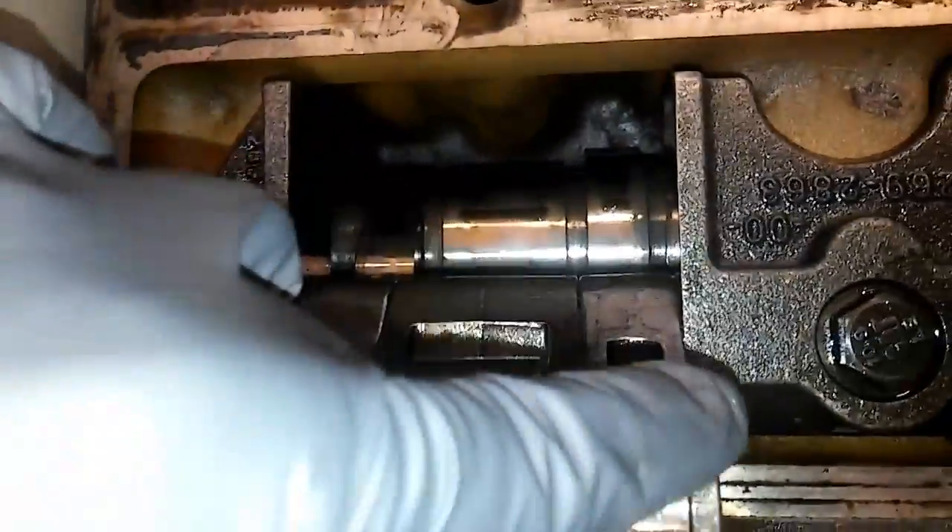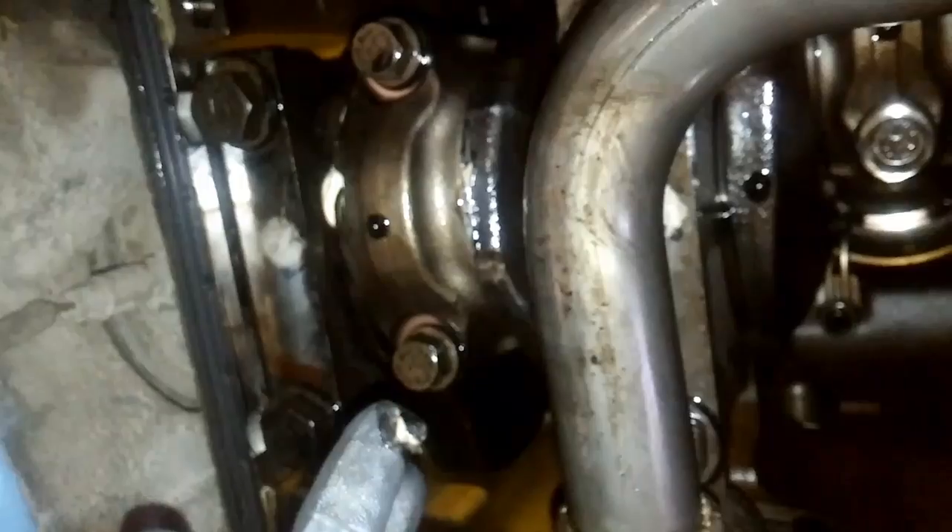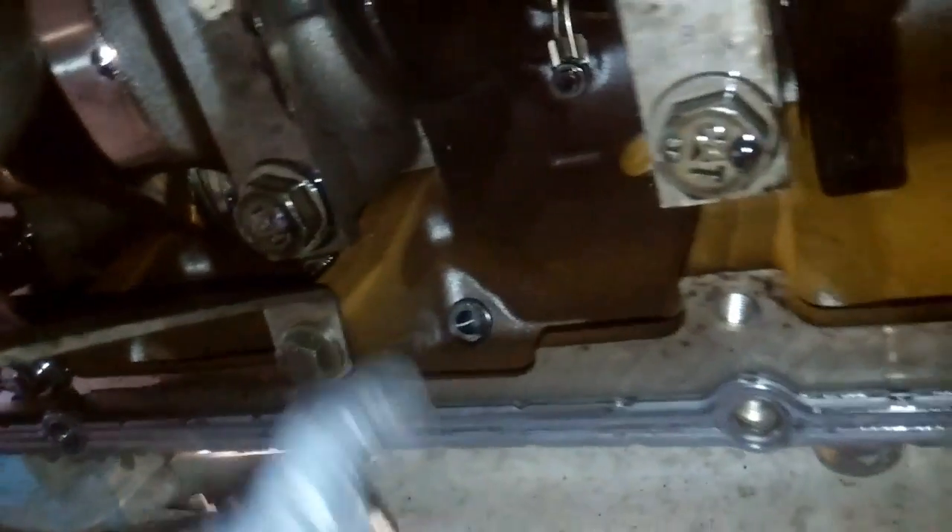There are all your cylinders, and this is a pushrod engine — I've already removed the pushrods. You want to take a look at the rollers and the camshaft while you're here. If they're not planning on replacing them, you want to make sure they're looked at before you put the head back on. Oh — there's no oil pump on this engine. Wait — that's a C13. These actually use an external oil pump, which sits right there under the water pump. We have your number one connecting rod, and it has assembly grease on it — I believe the customer may have disassembled part of it before bringing it in. Pointing to the cooling jet there that sprays oil onto your piston. We have your number one through six connecting rods, and seven main bearing caps, also numbered. There's your number six connecting rod, and you have your oil block plug there, which we'll be covering in future videos.